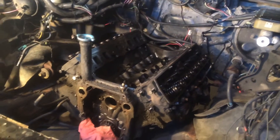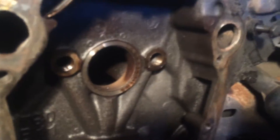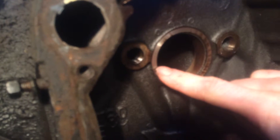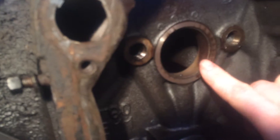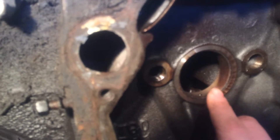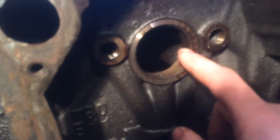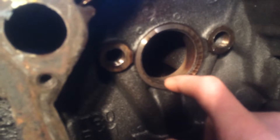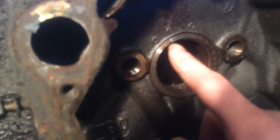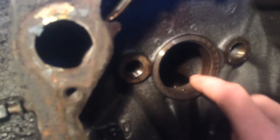But this isn't just going to be a simple cam replacement. Unfortunately, I kind of had a feeling these bearings were going to look like this after I started tearing into this engine. As you can see, this dark layer here goes all the way to about here — what this dark layer is is sludge. The reason that's formed is because this bearing has a bit of a copper tin on the bottom. That copper tin is the mid layer of the bearing, because there's supposed to be a layer of babbit over this copper. Over time, the camshaft just kind of wears that babbit away and starts riding into the copper. Whenever the camshaft gets pulled down a little bit, the clearance is increased from this area around here to the camshaft itself, and it just kind of lets the oil lay in there and it ends up turning into sludge.